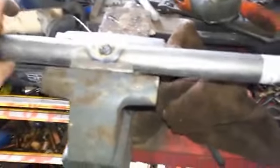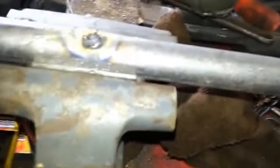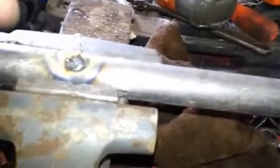This is the support member for the Nerf bars. That'll go across the frame. And the old one, they put a pipe on the outside. Well, I put mine on the inside, so it's cleaner looking. And just did a little, drilled a hole and filled that with a weld. So that locks it in there.